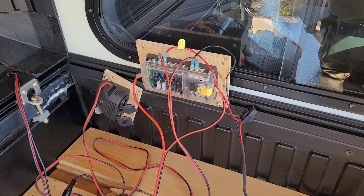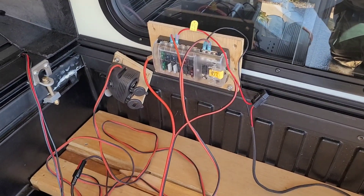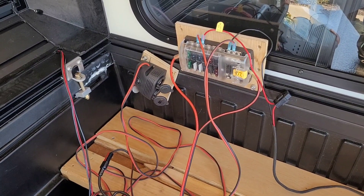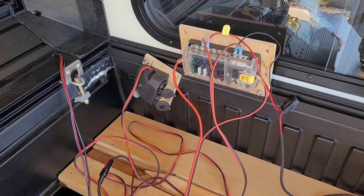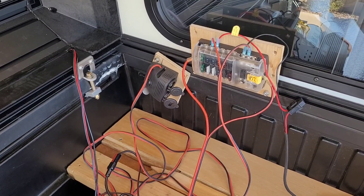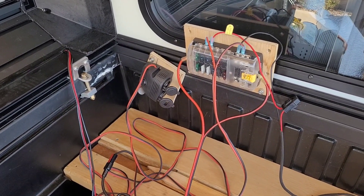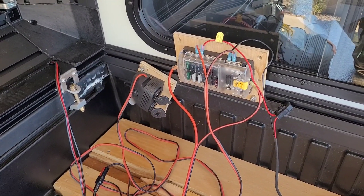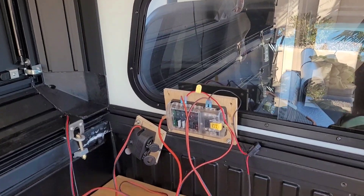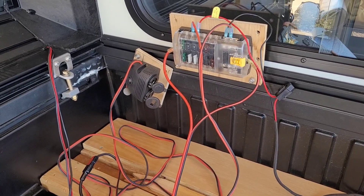The last potential circuit is a 12-volt water pump, but most people are abandoning constant-on water pumps and going with a rechargeable USB pump like the Dometic Go, which just sits on top, has no permanent wiring, is cheap to recharge, and lasts for months. So you could get away with a six-circuit DC fuse block. I got 12 circuits — it only cost five dollars more and now I'm ready for any expansion.